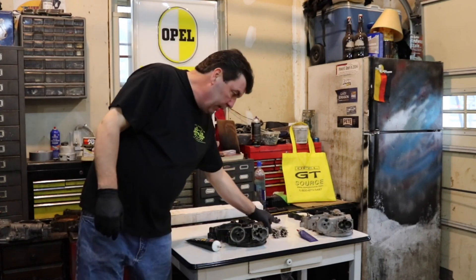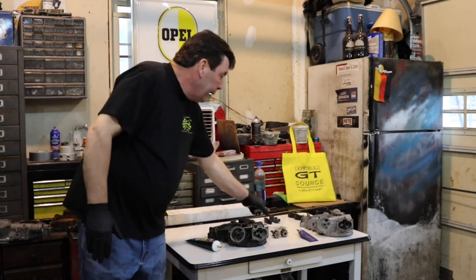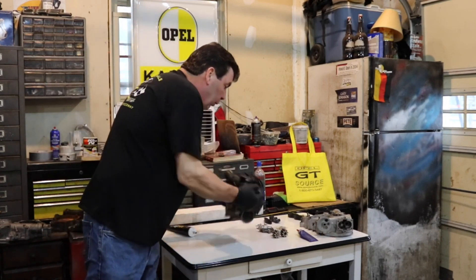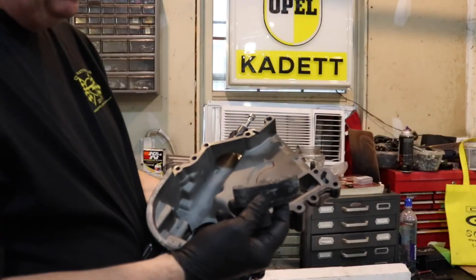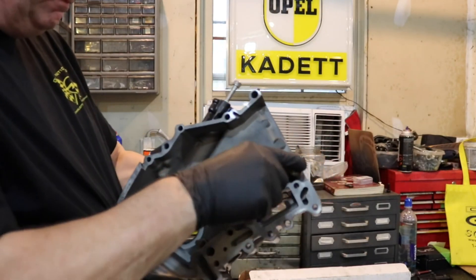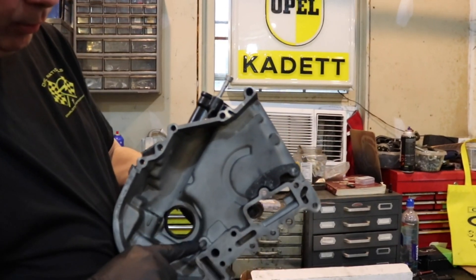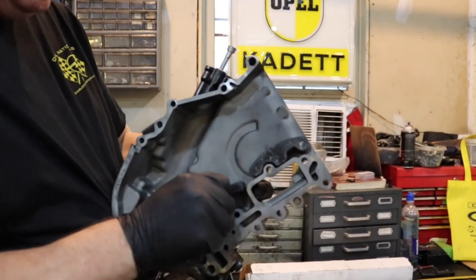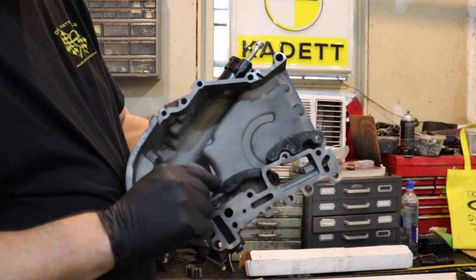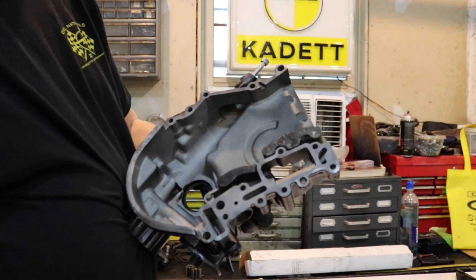With that and any good cover — as long as the cover's not worn out or showing deep grooves — you'll be okay. Putting the timing cover together is not very hard. You've got three pieces: basically the big end and the little end. Slide it right on there, it pops right in place. This normally has a little metal clip that goes here. Remove it so you can put this on, then go back later and put the little clip back. That's it for assembling the timing parts on the inside of the timing cover.